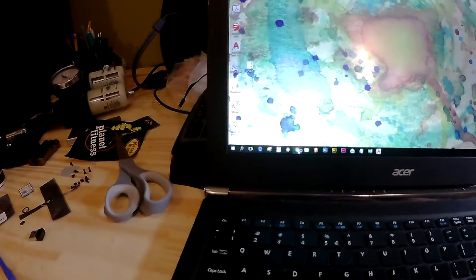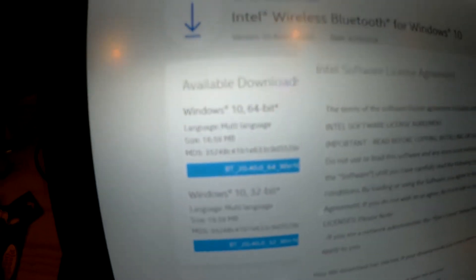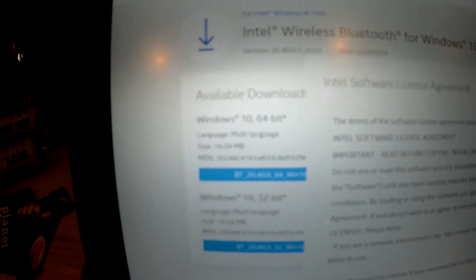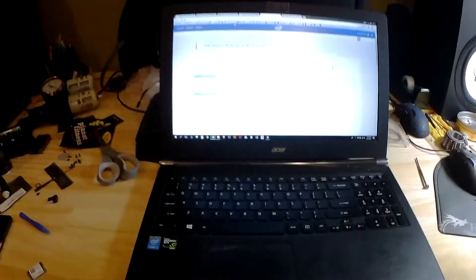I'm going to unplug this USB Wi-Fi dongle, go back in here, and launch Wi-Fi — didn't even have to install drivers or anything like that. Do we have internet? Yes, we do. The Wi-Fi worked, but the Bluetooth didn't until I installed the Bluetooth driver straight from the Intel website. I just Googled Intel Wireless N7265 and downloaded the Windows 10 64-bit Bluetooth driver. Once I did that, Bluetooth worked perfectly. So that's how you install a wireless card. Now you can reinstall everything, put the screws back. Thanks for watching.